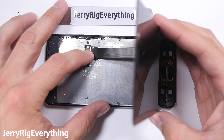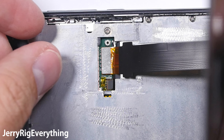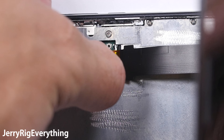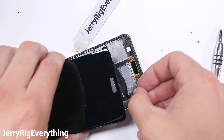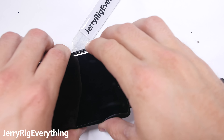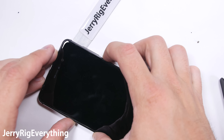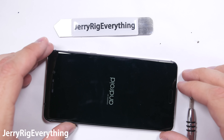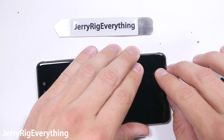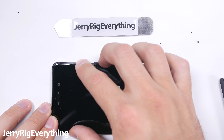When putting the circuit board back into place, remember that it slips underneath the metal tabs along the bottom of the frame. I'll get the 4 screws back in there. The extension ribbon plugs into the bottom of the motherboard before setting it down into the frame. When setting the motherboard down, it needs to tuck itself into the top of the frame first, under the metal tabs protruding from the frame. I've never seen a phone built like such a tank before, but I'm not complaining. The volume and power button gets plugged in next, as well as the headphone jack ribbon — these will both snap into place like a little Lego. There's a little metal bracket holding these down as a second layer of protection.